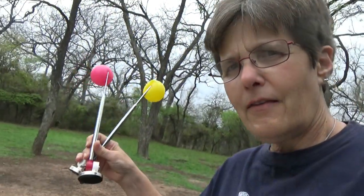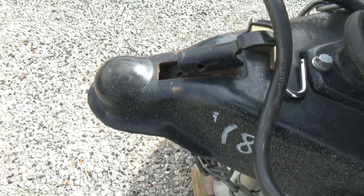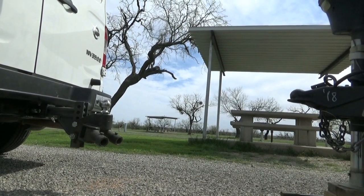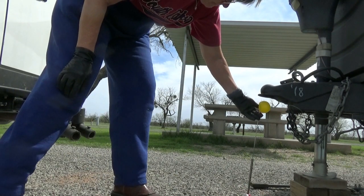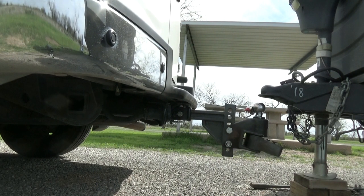Once I get to where I'm just a few feet away, we have these two balls on telescoping extendable poles — like radio antennas used to be. They have heavy-duty magnets on the bottom and they're actually made to line up travel trailers. I use this to measure the ball height and make sure that the ball height will fit under the tongue of the trailer. You may need to jack the front end of the trailer before you start backing in. As I'm backing in, I keep the distance in the mirrors even on both sides, and then I use one of these on the ball so I can tell when I get close enough — it will just tap that over.